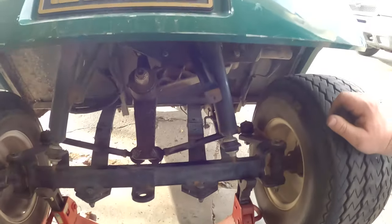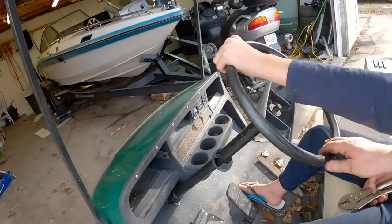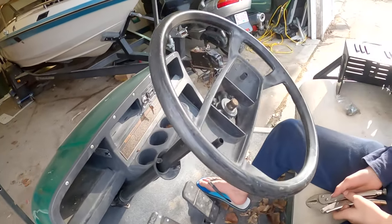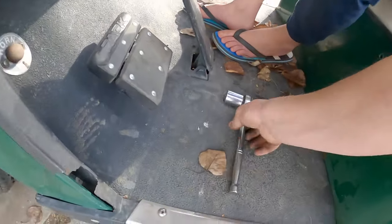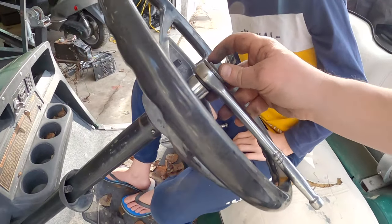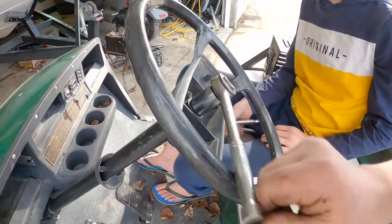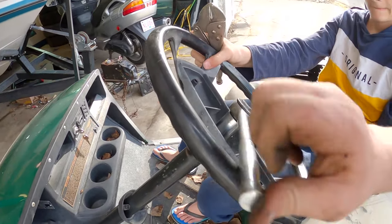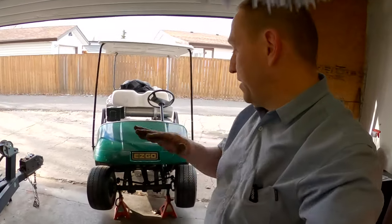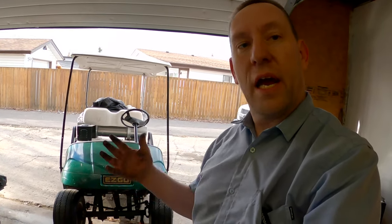All our bolts — make sure they're tight. Our steering wheel's not perfectly straight, but it's straight enough. I'm going to put the nut on with our 24mm socket to complete the install. And that's all there is to replacing the steering box on your Easy Go golf cart. Now we've just got to let it off the jack stands and give it a quick test ride.